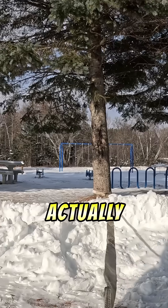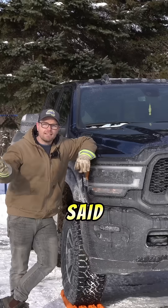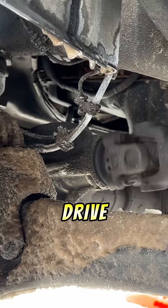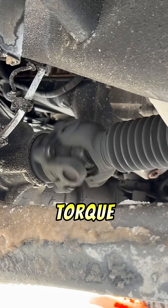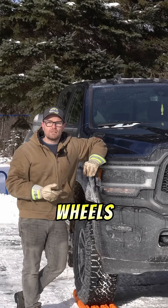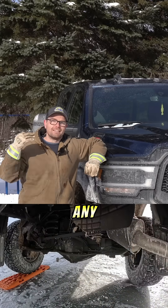I've tied this old girl up to a tree, which is actually not the first time I've done that. What I said is that four-wheel drive low is simply a torque multiplier in the driveline. Yes, it will allow more torque to flow to your wheels and may give you better control, but it does not actually add any traction.